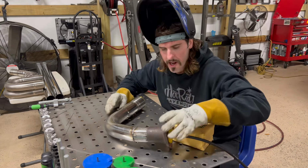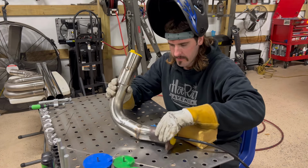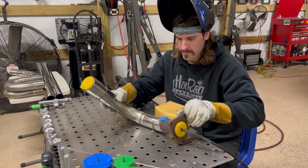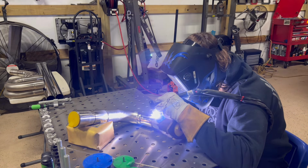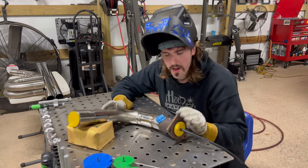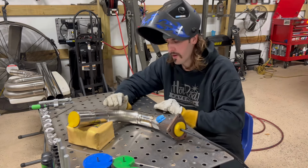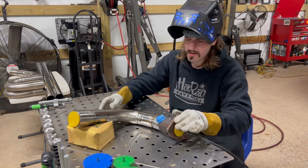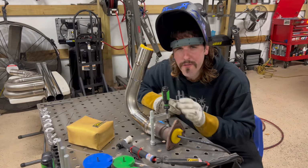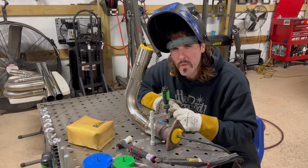That ran pretty good, yeah. Let me try to. I'm welding this right here, 409 to 304 with a 309L rod, y'all. All right, y'all, I'm gonna go ahead and finish welding this thing out. I'm gonna cut y'all back on whenever I'm modifying for this wastegate.